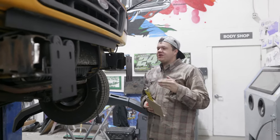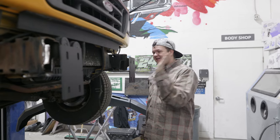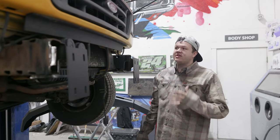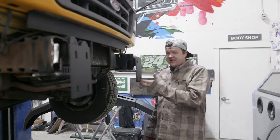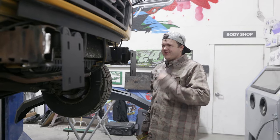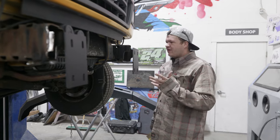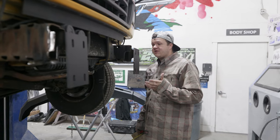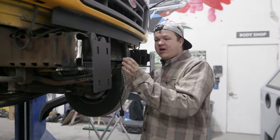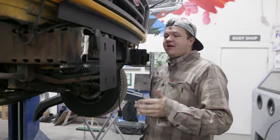We're moving forward on converting the 2017 Barnes Four-Wheel Drive front bumper to fit onto a 2002 Ford E-series van. This E-series van is going to be a four-wheel drive, so it's eventually going to become an F-series van. We're using an F-series front bumper, but there are some heavy modifications required — I actually had to cut the end of the frame off and I've got brackets that I'm welding to the bottom side.